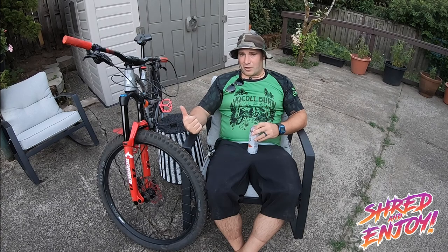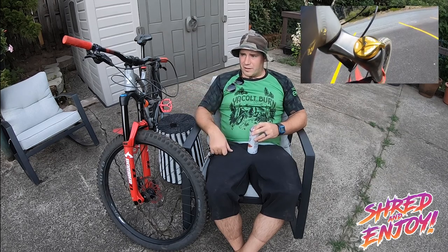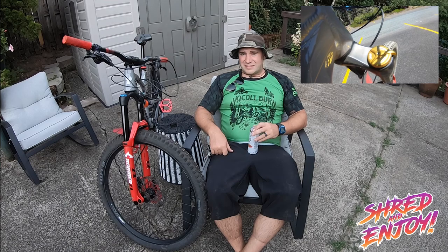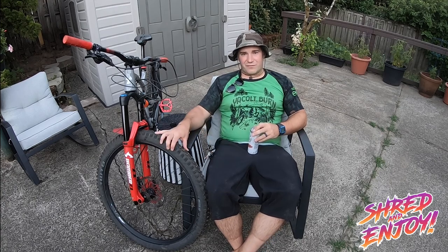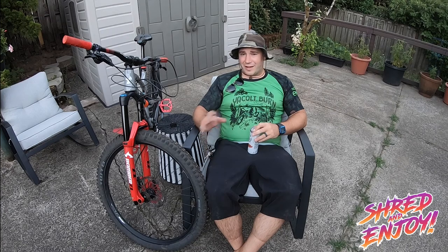The Grip One Damper, the Flow One specifically, doesn't even have notches rolling in place. It's just a smooth turn. Some people really like it, some prefer it over Grip 2, and some say it's more tunable. I knew that about 2:30 or so was where I wanted to be for more technical stuff — extra soft to handle all that chatter and chunder. Then about 3:30, 4 o'clock is where I wanted to be for flow trail — a nice firm feel, really good tire feedback, and better landings on jumps. The problem is, could you have both?